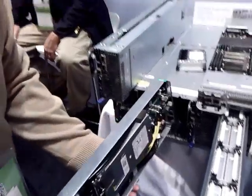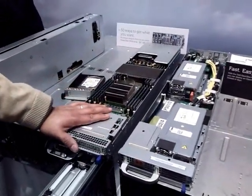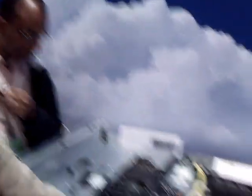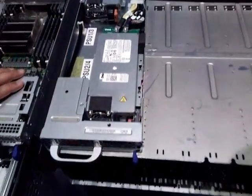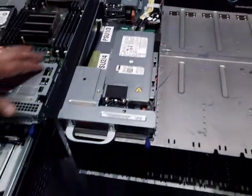One thing I'd also like to show you is the actual power supply sled. From a form factor perspective, dimensionally it's about the same as a computational single-wide sled. The difference is really the internals — as you can see here, there's a stagger of conventionally sized power supplies, but the difference is the way we utilize the space for a different function to operate within the chassis. This infrastructure will have provisions for in-row power supply and external power supplies. This lets you mix and match and put power supplies on board right together if you like.